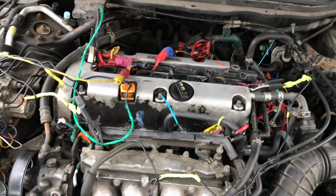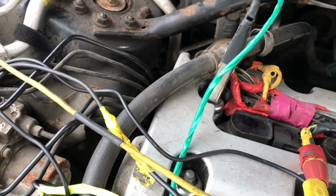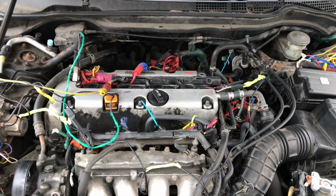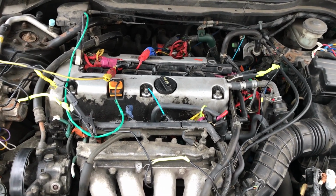We're going to be on 4 channels. Channel A, orange, is going to be the microphone clipped to the front of the cylinder head in fairly close proximity to the timing chain and the cam phasers. Channel B, purple, is on the back of the cylinder head. The reason I went with 2 microphones is just so we can offset any bias created by a noise in a specific location. We get that much better look at a possible noise.